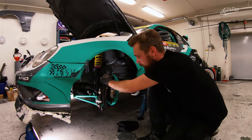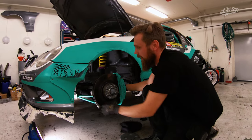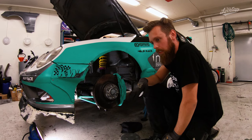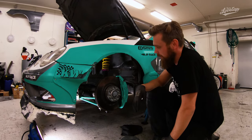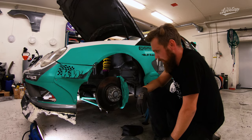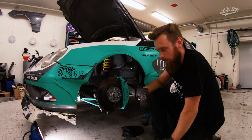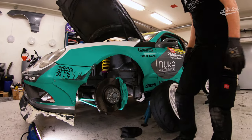It's 55 degrees of steering angle and it's not completely zero Ackerman. I like to have a bit more on the leading tire because that's my preference, but everybody is different — you have to figure out what you like most. Let's move to the rear suspension.